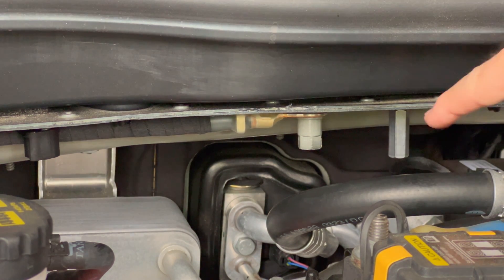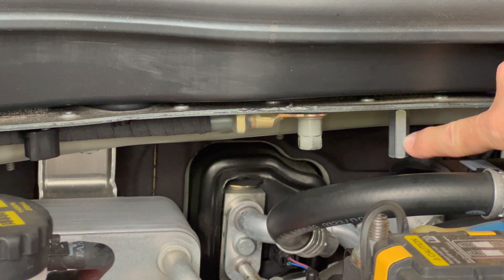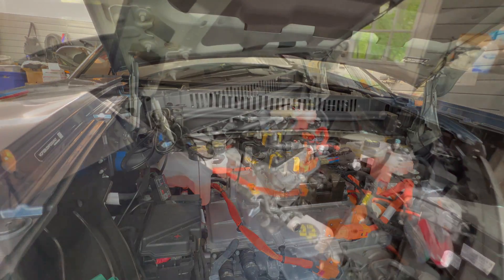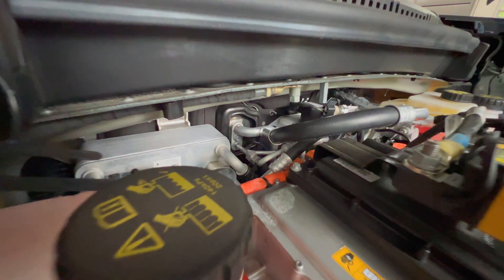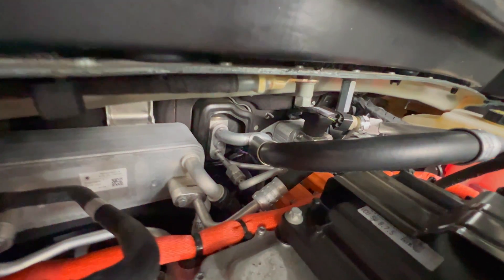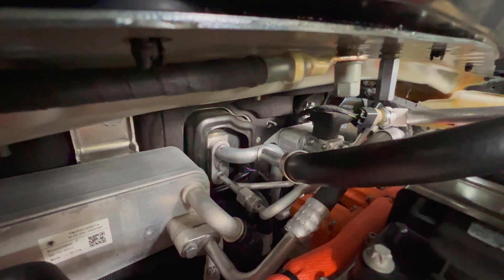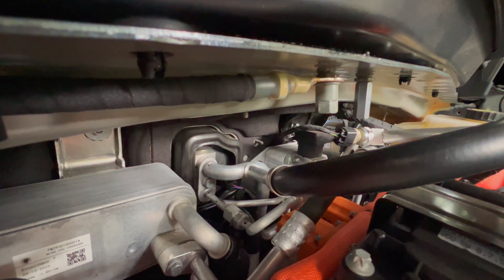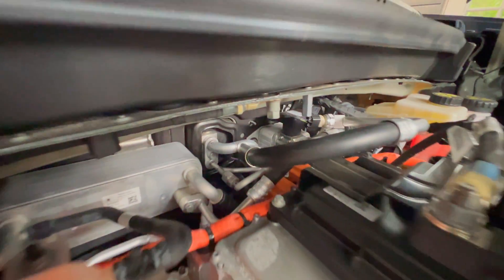By the way, this is the area you would use when boosting the car. For example, if you want to jumpstart the 12 volt battery you would attach to this post right here. Christian had mentioned in his post that several times he had seen this cable disconnected either at port or at the factory and not tightened to specifications, which can cause the grounding nut to unscrew itself over time while driving or just be loose enough so that the vehicle will have no connection to the 12 volt battery ground.